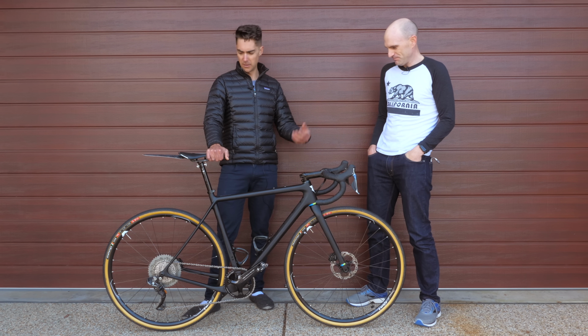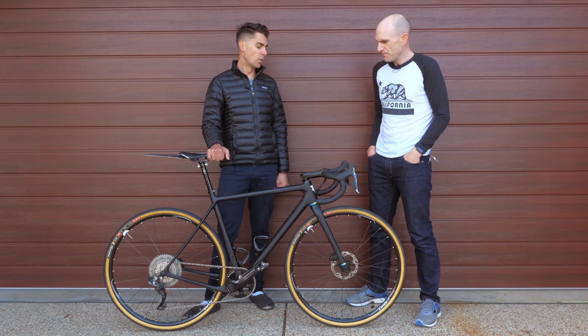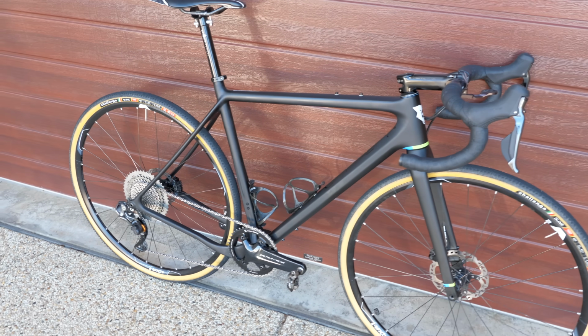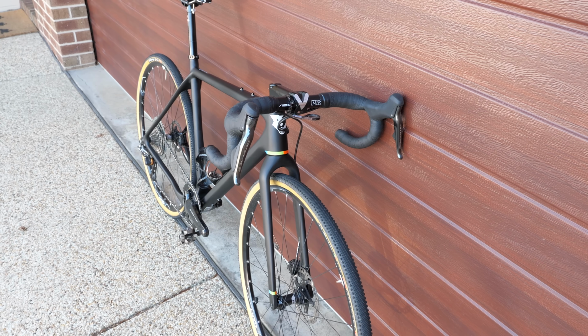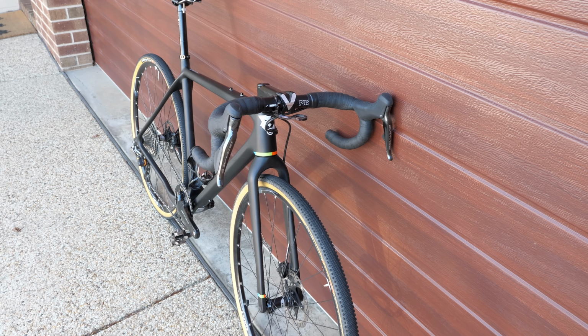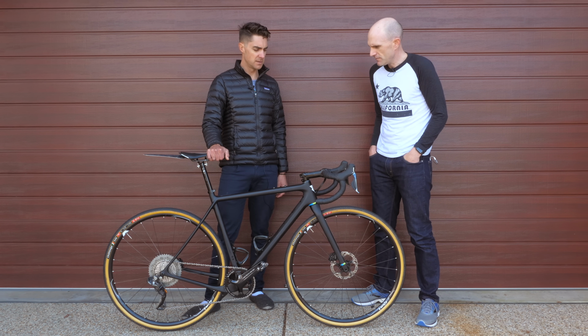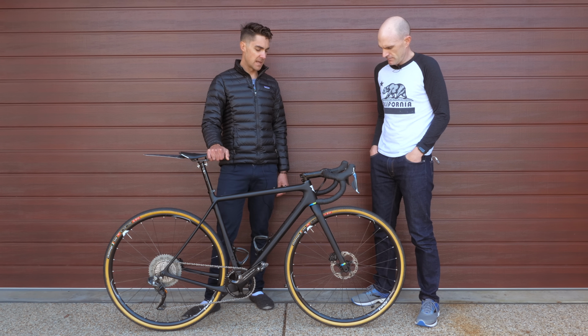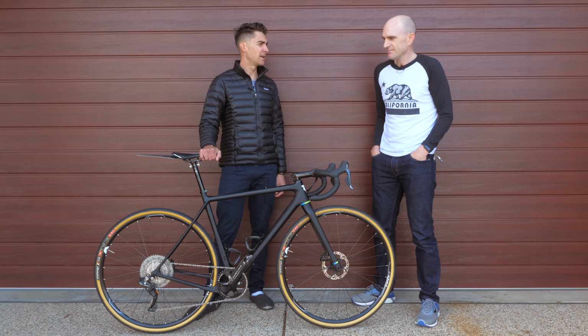Awesome. But you can switch out the tyres to a chunkier tread, or what I'd like to do is go the 650B rims and run a bigger volume tyre, because it's not about grip, it's about the suspension, the bit more give that a bigger volume tyre gives you. Yep. That would be nice, because it's still pretty bouncy going down a corrugated road.